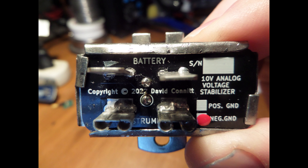What are the advantages of my rebuild service over the existing voltage stabilizers on the market? Number one, the voltage regulator is specifically designed for automotive applications and has reverse polarity protection — although the leads are polarized, you just never know how they're going to be hooked up. Secondly, the voltage regulator is thermally and mechanically bonded to the metal case for maximum heat transfer, since heat is the major killer of integrated circuits.